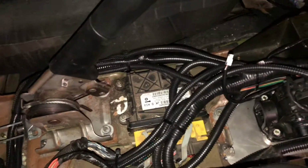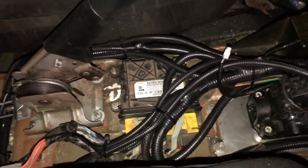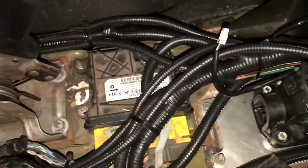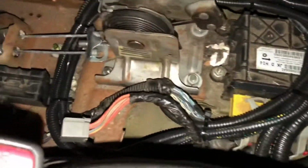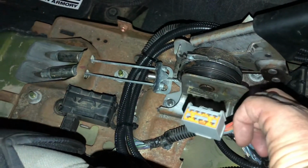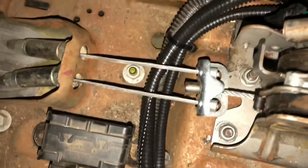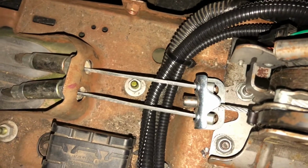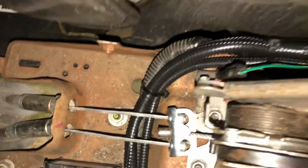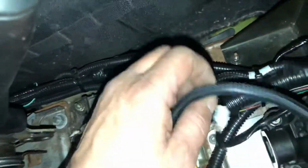Right, so this is going to be part number 3. Now that we got the CAN bus wired in, as you can see, there's a lot of wires, but everything's all cleaned up, zip tied together. This one's going to go to the switches in the center console, for the windows, that kind of stuff. You want to make sure you route all your wires underneath the parking brake, so that way nothing gets rubbed on or split through. So the CAN bus is all wired up and cleaned up and everything.